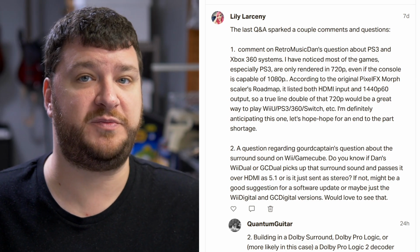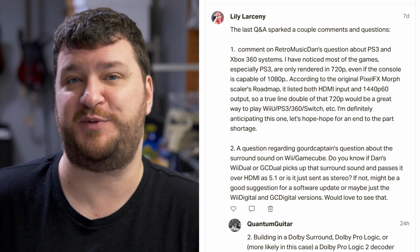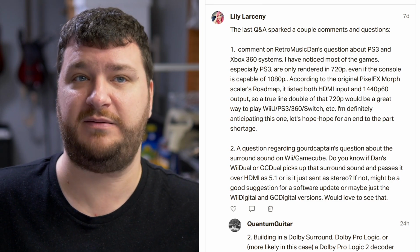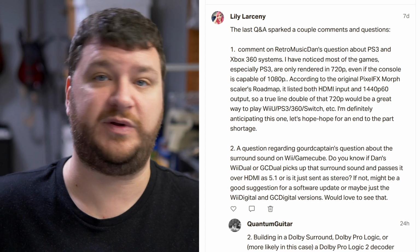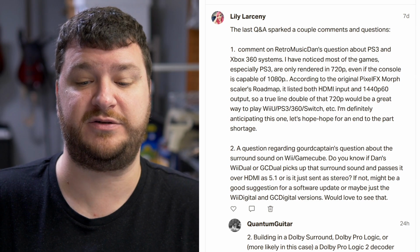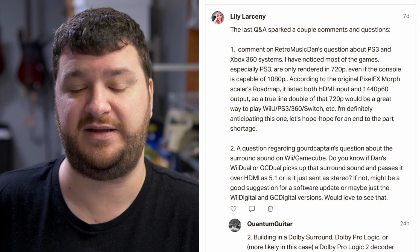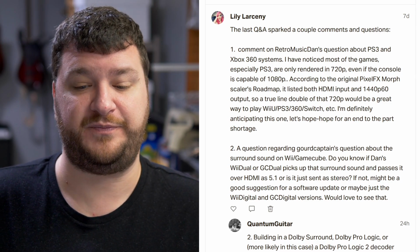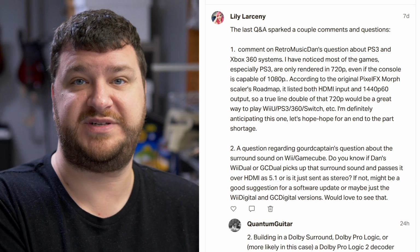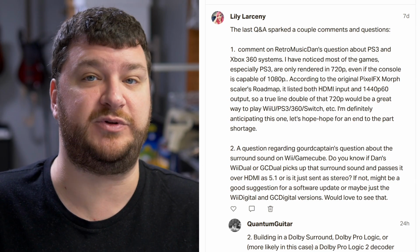And right off the bat, they should be able to do nearest neighbor line doubling, which means if you have any of those games that are retro style shmups or something like that, you could get the sharp scale to 1440p, which would then make the end result of being scaled to like a 4K TV a little bit sharper than the original. However, both of those scalers should hopefully have more options so that you could decide exactly how you want it scaled. And something like the M cable that is specifically designed to smooth out from 720 to 1440, I would hope that something is possible in those scalers.